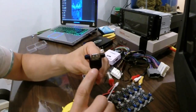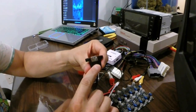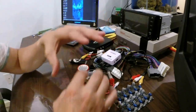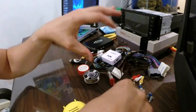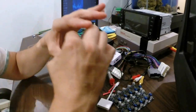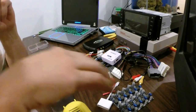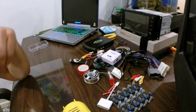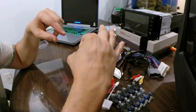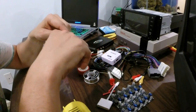You might ask about that extra USB — I'm still waiting on the part, but I've ordered a port about this big around. It's going to have HDMI on the bottom and USB on the top, and I'm going to countersink and permanently mount it inside the armrest. Jeeps already have a USB and a 12 volt cigarette lighter input there, and beside that we're going to drill and add an HDMI and USB input.